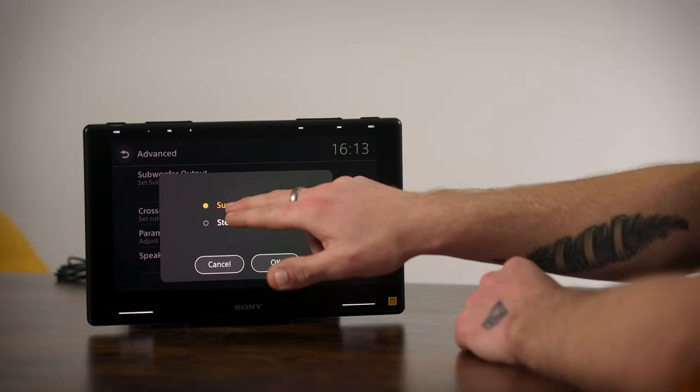You can save EQ settings for just one speaker or all of them. Speaker configuration lets you set front and rear setup, or if doing an active front end you can go 'front two-way' and select that. You can then change the crossover with subwoofer crossover, mid low-pass, mid high-pass, and high settings. You can set it as a band-pass - for example 63Hz low and 4kHz high - and see the crossover slopes update visually.